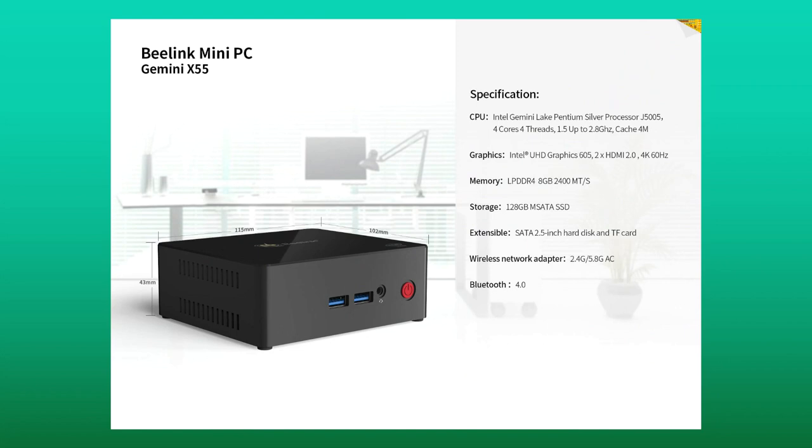The machine itself, you can see here the specs are on the right, so we've already covered the chip. But interestingly, this particular model comes with a 128 gigabyte mSATA mini drive built in. Now that's removable, it's slotted, you can upgrade it to your heart's content, but it actually is a nicely performing drive. I haven't benchmarked it, but certainly others out there have done videos on this, and it performs not quite as good, but within a hair's breadth of the things you'd get from, for example, Western Digital or Samsung. So although it's a cheaper Chinese drive, the performance is actually very, very good indeed.